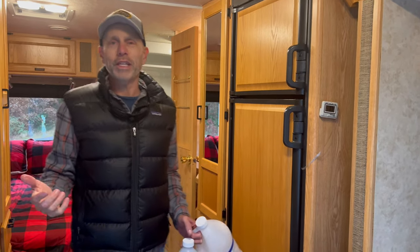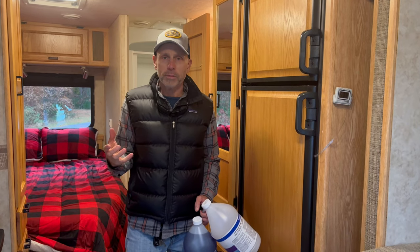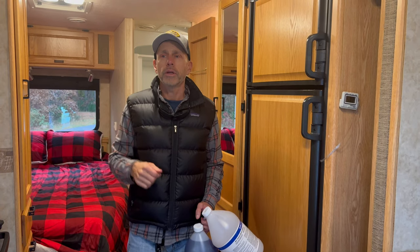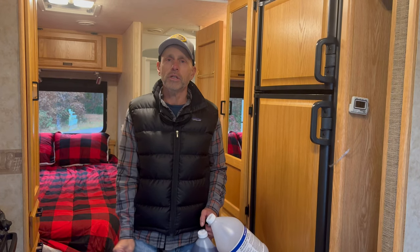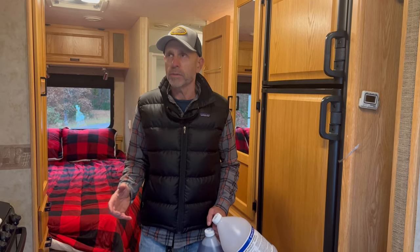And then you would want to put something in like a desiccator. You can get something at West Marine. It's like a chemical desiccator. They have a few different types like that. Or if you've got the ability to be undercover, have some ventilation, open a roof vent, have a window so you can have convection ventilation, because they can get moist over the winter. This unit is like brand new. It literally doesn't have any musty smell at all. We want to be able to maintain that.